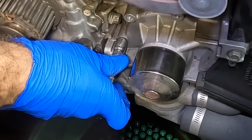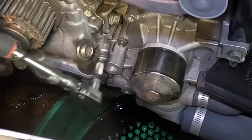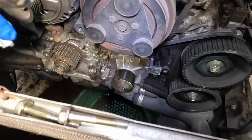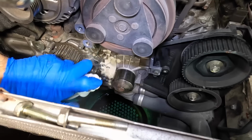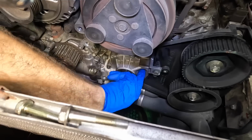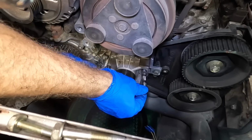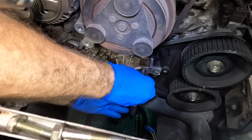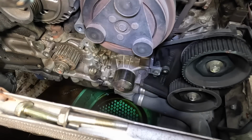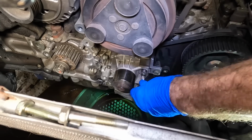Yeah, I can feel the fastener flexing. We need some lubricant in there. This is not okay. This is actually a bad emergency. Let's try some lubricant here. Just hose that down some. Hopefully some will soak in enough to get that loose. In the meantime, I'm gonna get the other bolts loose, if they will come loose, and maybe I can separate this water pump from the block a little bit and let some of that penetrating oil soak back behind it into the threads.